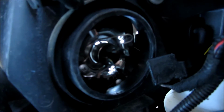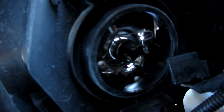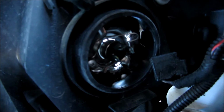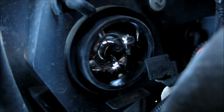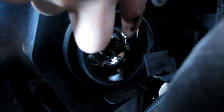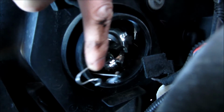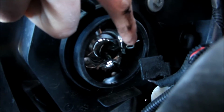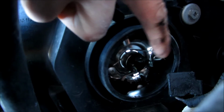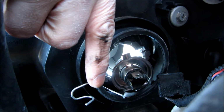Next you can take out the bulb. This isn't great visibility on this video, but on the far right there is a clasp or hitch, and you just push in slightly and then lift up slightly, and it'll become a little bit more apparent when the clasp is loose. You'll see my finger here. I'm going to push in, lift up a little bit, and you'll see that there is that bottom bit that gets caught, and that's how it closes and also pins the light bulb into the socket there. That's the mechanism that is being used to hold that bulb in place.